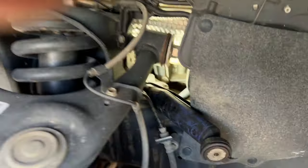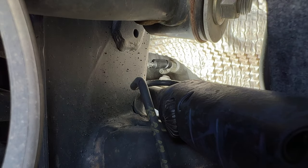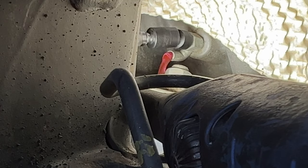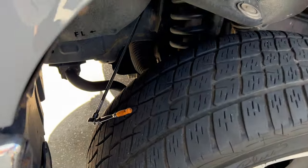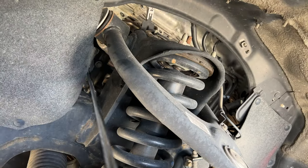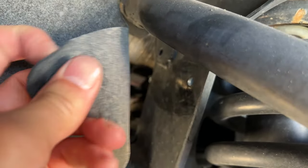We're going to drain it — that's going to be over here on the driver side first. See that right there on the engine block? That's one of the drains. This is the driver side; I'm on the other side near the front bumper. Let's see if we can crack this loose. That took a lot longer than I thought — about 10 minutes to get this drain — but it's done now so I can just give it a little tighten up. Looks like this little clip has had it; I actually didn't have to pull it out, it was already hanging out, so let me go ahead and replace this thing.